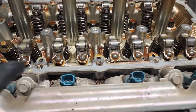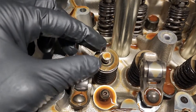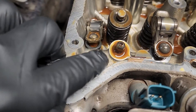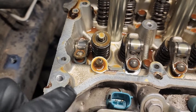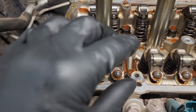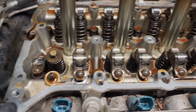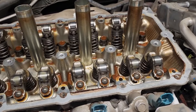Now at this point you're gonna want to pull the rockers off, and also pull the little cap off the top of the valve, and then you want to pull the hydraulic lifter. Try to keep those organized for each one however you can — if you do get them mixed up it's not horrible, but it's best to try to put everything back the way that you removed it.